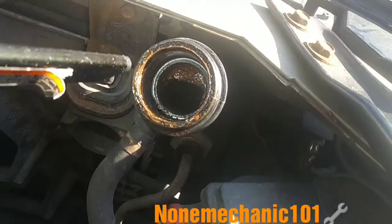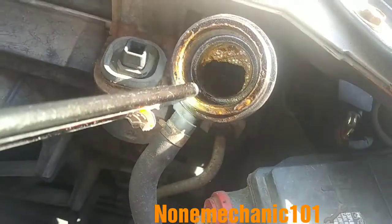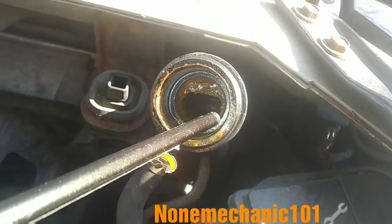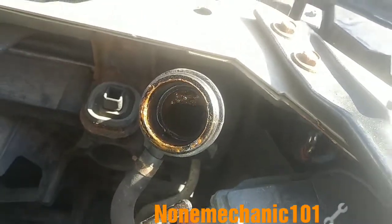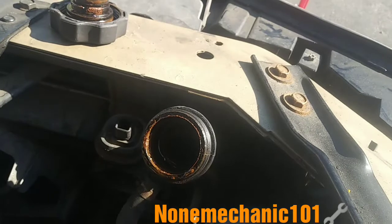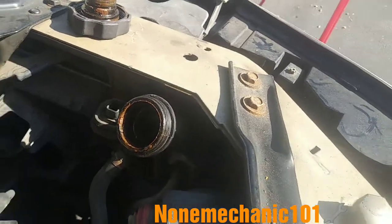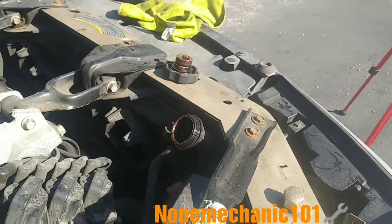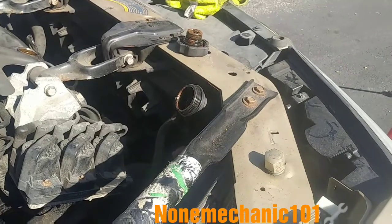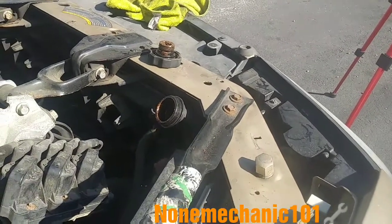So this is how it is looking in there — got all this gooey stuff all the way down, it looks like rust, and I don't really know what it is, it is just so gooey all the way down. My plan is to give it a cooling flush and then let it run for a while and see if I get any smoke, any bubbling — do the full diagnostic for a blown head gasket. I am not sure on this one, that is why I am making this video. Also, let me let you know that this car is not smoking at all, not throwing any type of smoke — it just doesn't have the oil and this cooling system is all gooey.